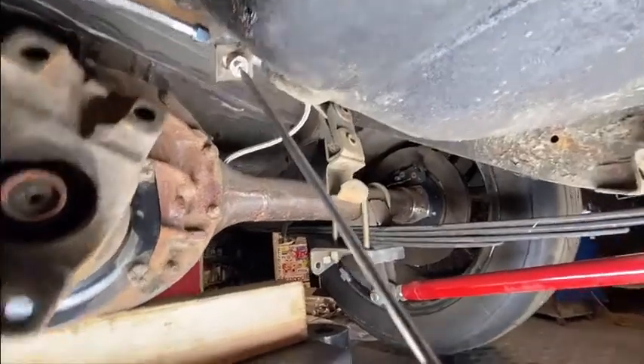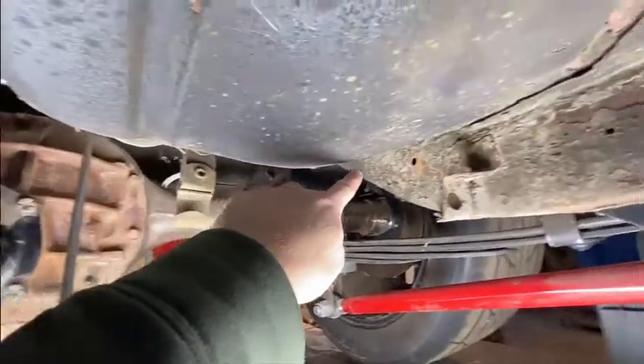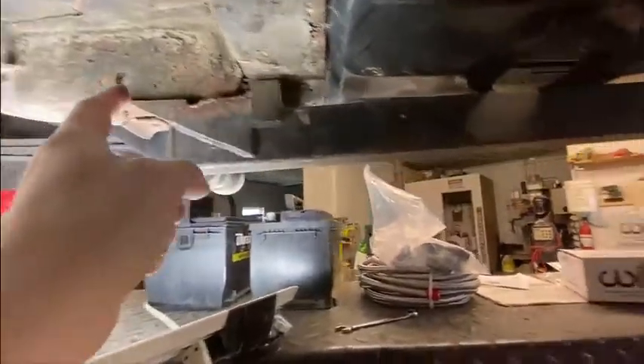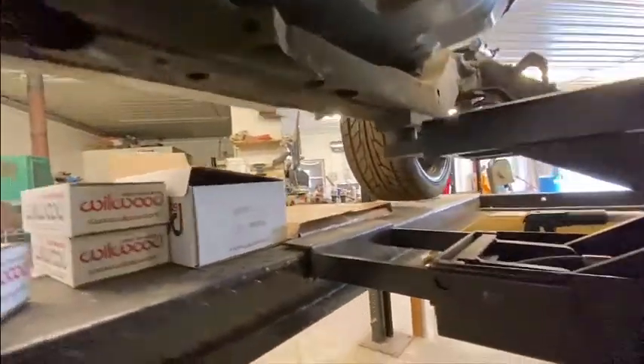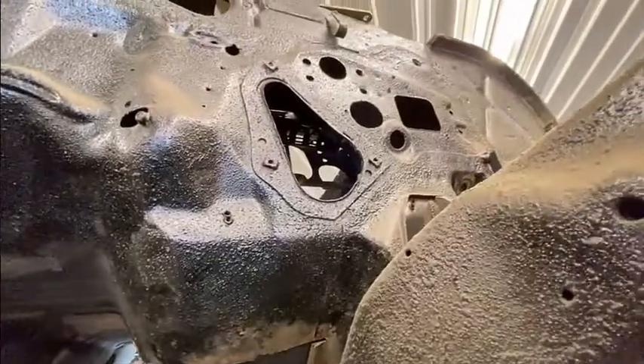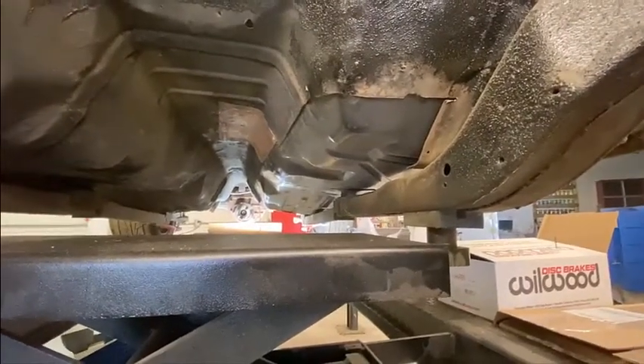We got it plumbed in - it's somewhat tight so this is going to be the bend. We're going to come here, go over to the rail, run it through here, have it clipped somehow. We've got to figure out routing - these are subframe connectors - and run it all the way up the frame. You can run it on the outside or inside of the frame rail, because ultimately we've got to get to the area where the brake system is going to be. I'll bend it a couple times with the bender and test fit it.